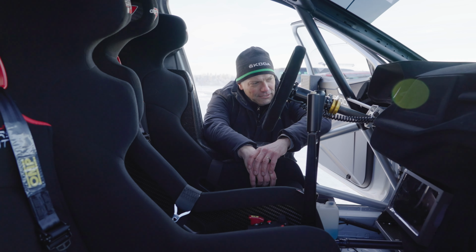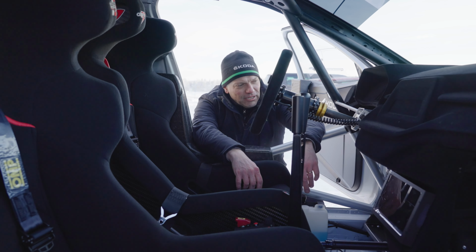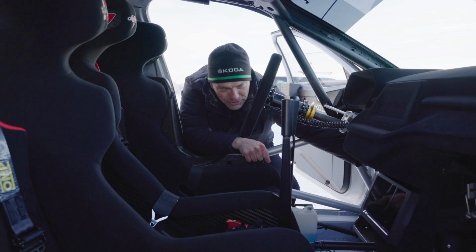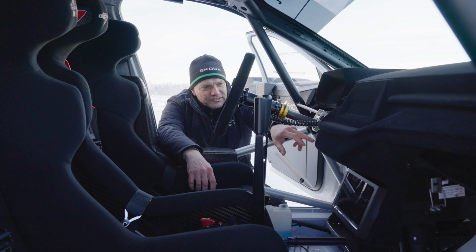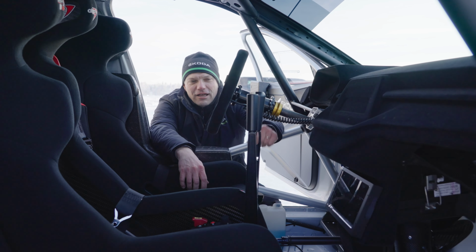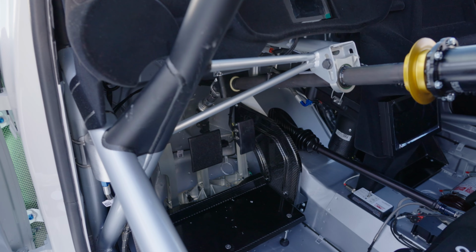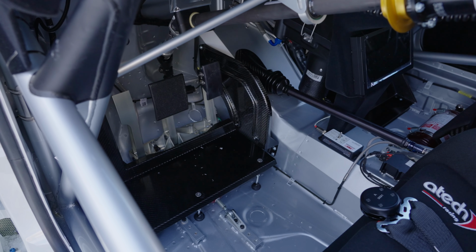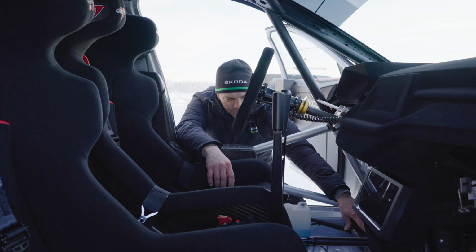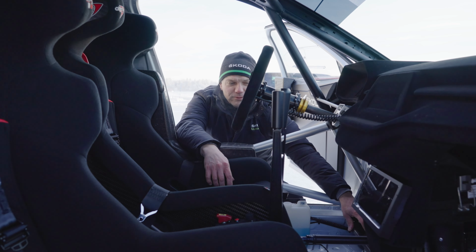But despite that, the steering column still needs to have a so-called crash element, so that in case of a hit, this rod collapses and does not attack the body. The pedal box is, let's say, from aluminum. These footrests are made from glass fiber or carbon fiber.